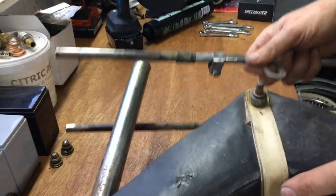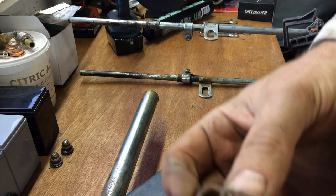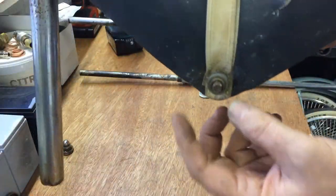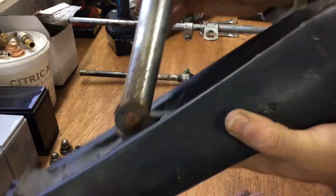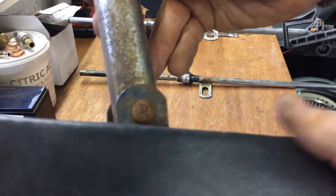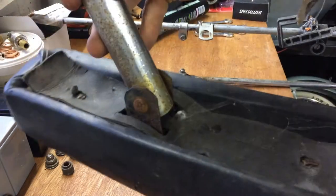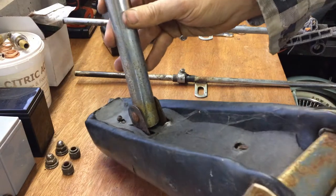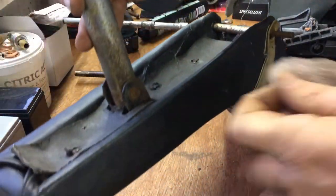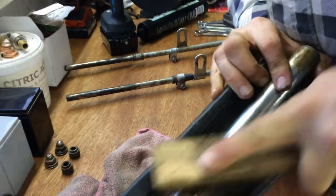So that lifts off. There's a big collar - the small taper goes to the outside, so on this side it sits like that. Now the seat post is actually riveted in - didn't realise that. I thought it would be like normal where you've just got a nut and bolt and it clamps on, but that's riveted in for sure. So I think I'll have to clean that while it's in situ - try it with a wire brush first.